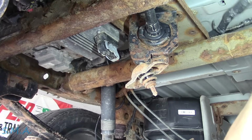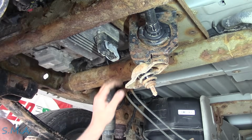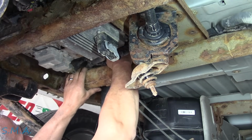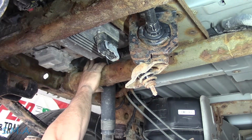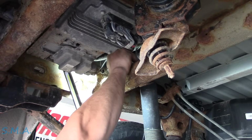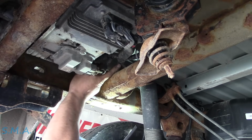That has a harness that goes that way to something else. We can't really pull this down and around. I'm wondering what else runs off that fuse, if we're able to use the old fox and hound routine. I'm typically not a big fan of that because most circuits go every which way. We do have a big open harness right here. So that's interesting. There's no tape on that whatsoever.